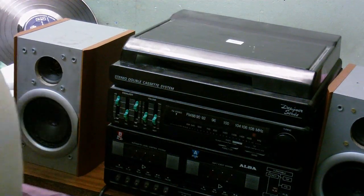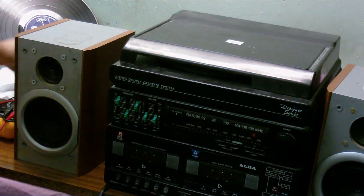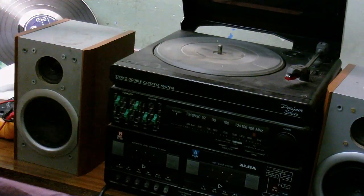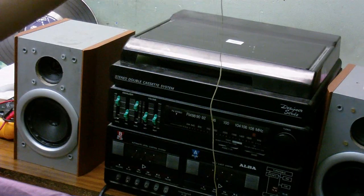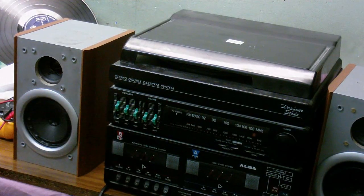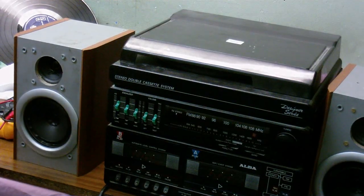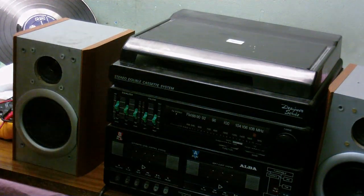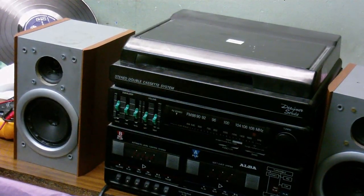Well, that's just about it. Something that says 'Designer Series' — you'd think it would be much better. But my thorough examination proves it's not really all that good: a record player with a plastic turntable and ceramic pickup, a very puny amplifier, a radio that uses a wire for the FM antenna, only a 3-band equalizer, and a DC-biased tape deck. Now I can see more reasons why they threw this away. I'm going to keep this for parts — I guess that's the best thing this thing is useful for. Until next time, goodbye.